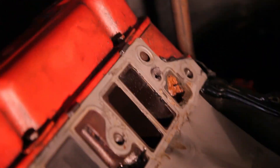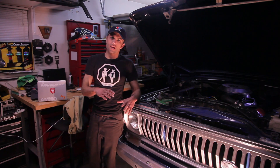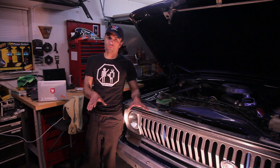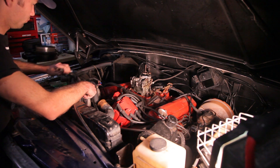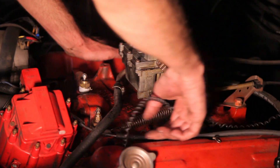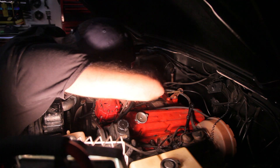So what I'm working on tonight is I've got to take the intake manifold off, put a new gasket down, seal everything back up, bolt it back up, and hopefully it stays leak-free. Basically to get the intake manifold done, you've got to take all the stuff off the top of the engine — that means a bunch of vacuum lines, the carburetor, the distributor, and a coolant hose or two.